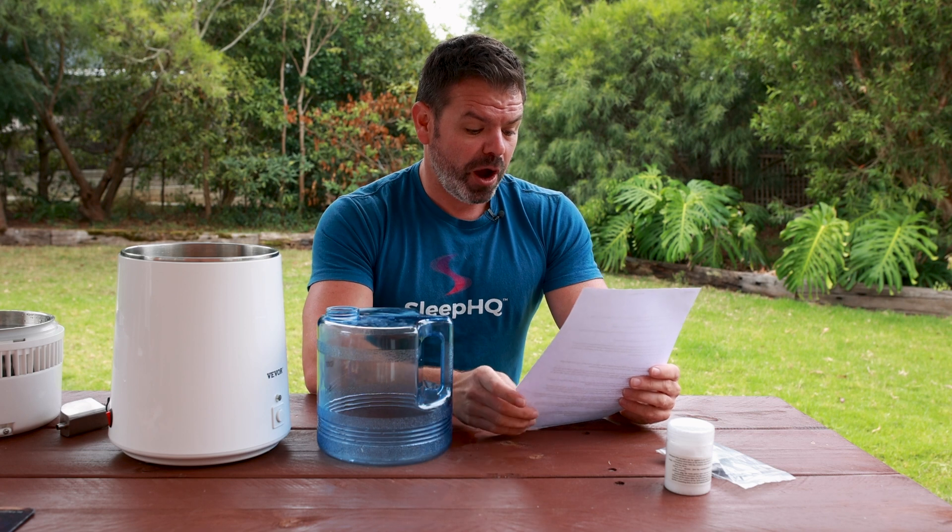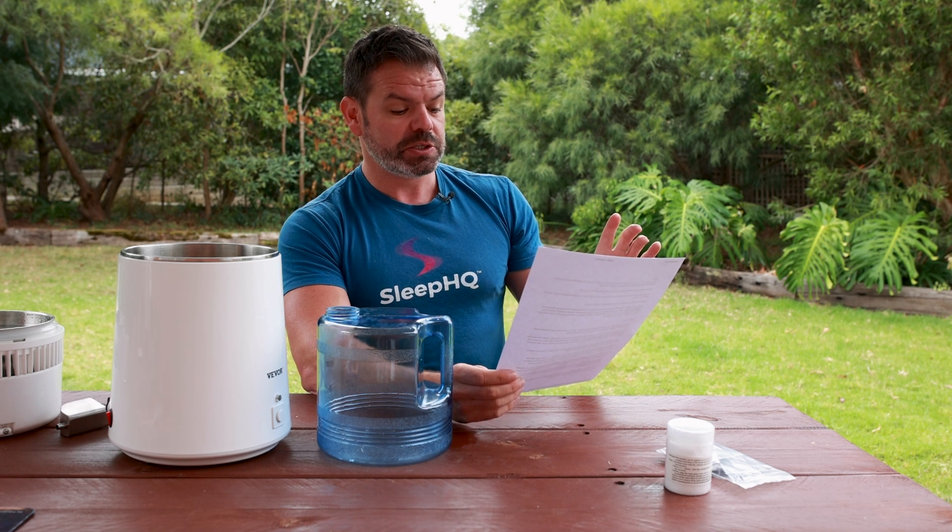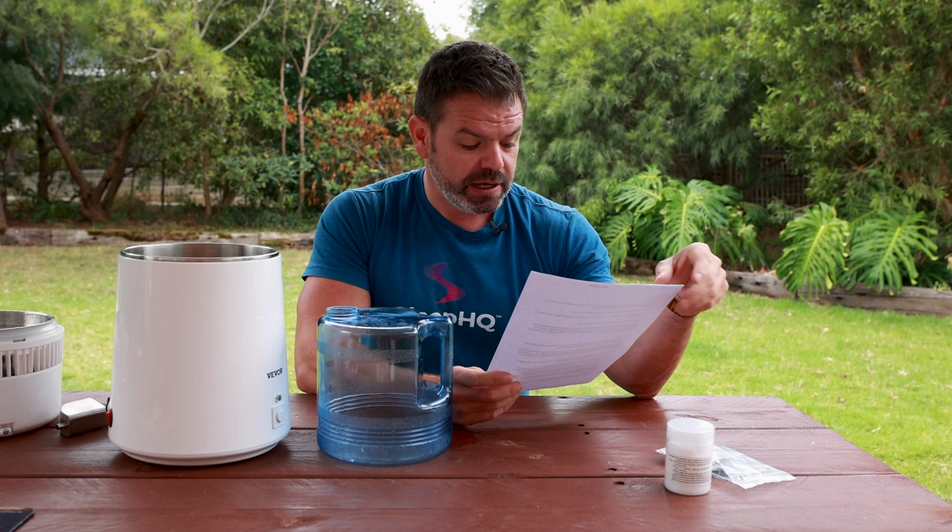Next up is Robert Lippman - he's been distilling water for his CPAP and humidifiers for a few years and has made several hundred gallons. His timer is set to 2 hours and 39 minutes - not 40, 39 - this guy has it down to a fine art. Aside from the first time he ran it dry using the built-in auto-stop, he has not collected any new scale since. Use a timer and figure out how much time your machine needs - scale will not be an issue.